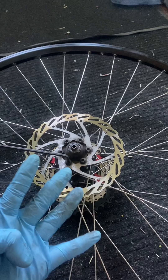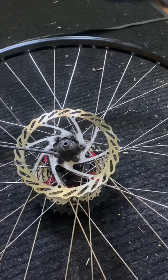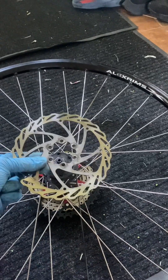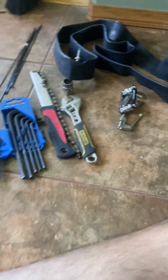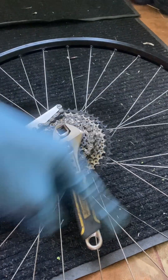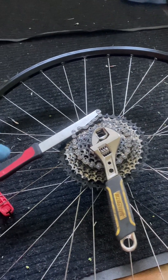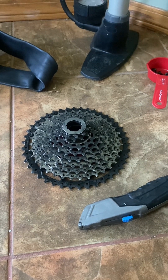Using 4mm Allen keys, remove the six Allen key bolts and pull the rotor off. Remember the orientation that the rotor comes in — make sure the rotor faces the correct direction. Have your chain whip wrapped counterclockwise, turn the adjustable wrench counterclockwise and the chain whip clockwise, and just like that your cassette is removed.